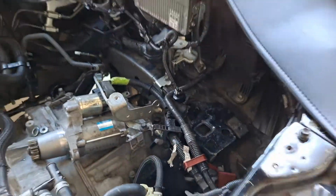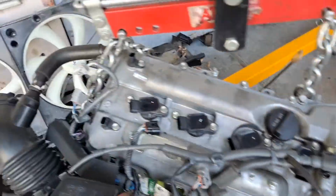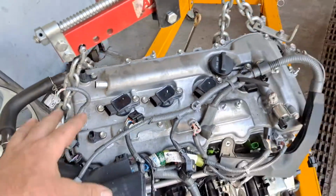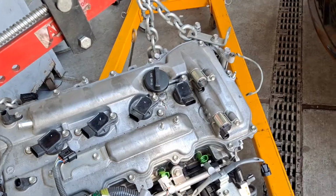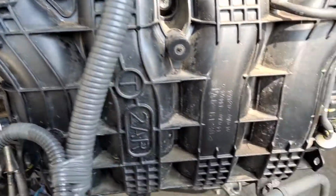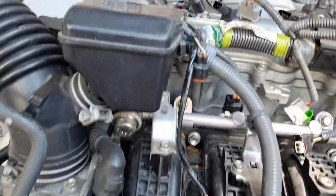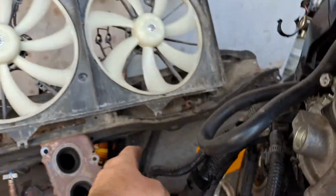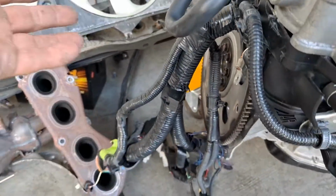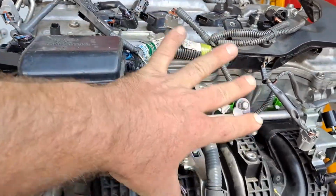You got the standard stuff on top. In this one, you won't just necessarily unhook it from the ECM, although in their case they did. You can do it a few ways. You can pull most of this harness off, but where you'll get hung up, this comes around. You'll have quite a few of these to do, and you can pull it off with no harness. Or, I'm okay if you want to disconnect it from the ECM and in a few spots, and pull it down with the harness. Either way is okay.